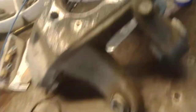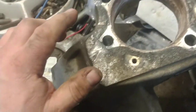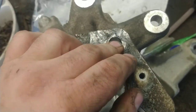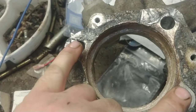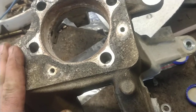This time it was just the simple fact that you couldn't get to anything. When this was installed in the vehicle, I had a 4-ton porto-power on this bolt pressing against the frame to push this out, and a 10-ton porto-power on this bolt pressing against a component to push that one out. Then I was alternating between these two holes — I had bolts in them — with an air hammer vibrating on them.